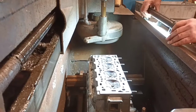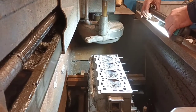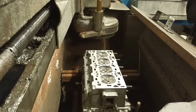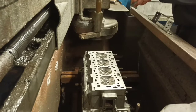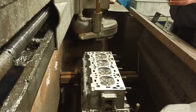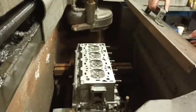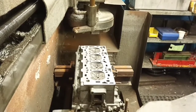That's just putting a good face on it, is it? On the stone? Yes, it opens them up. Obviously they clog up. If you're doing XYZ heads a day or a week, then obviously you might have to do that. It depends how many heads you're doing, three or four times a week. Because it clogs up the stone, so that dresses them. And I guess aluminium clogs it up more, does it? Yes, a little bit.